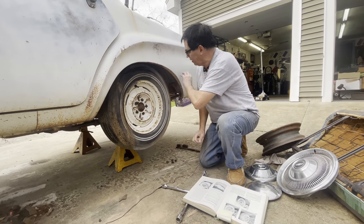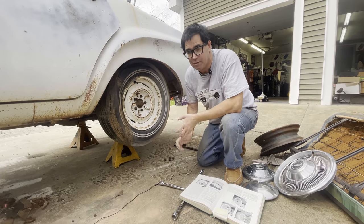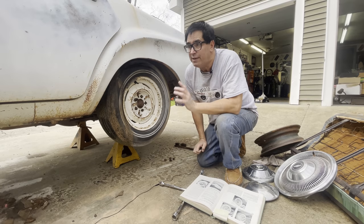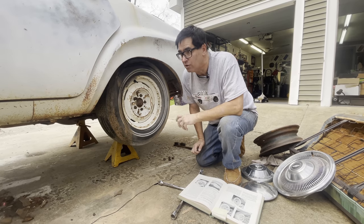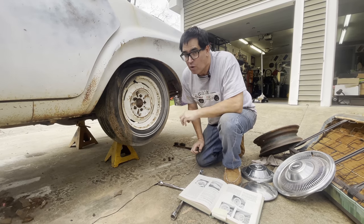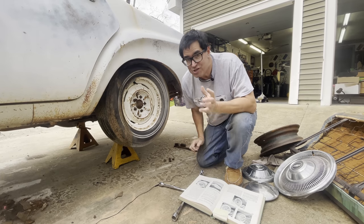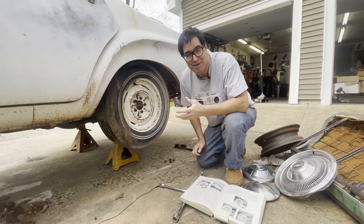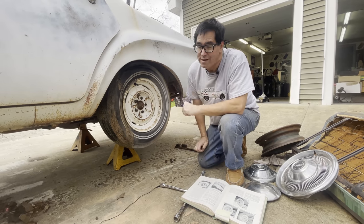It's very solid, very clean. As we saw in a couple of videos that led up to this one, the floor's not rotten because of the rubber floor mat, but this is a fleet car — a police car, code nine in the second spot of the VIN. Up front, we already saw the heavy-duty front suspension with the 11 by 3-inch Hemi charger specification brakes, first seen on police cars. The Hemi cars actually use police brakes, as seen here. We also saw the front anti-roll bar.